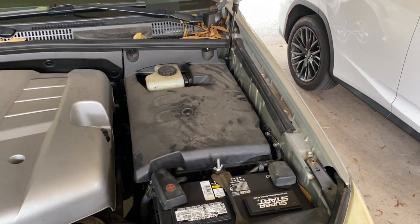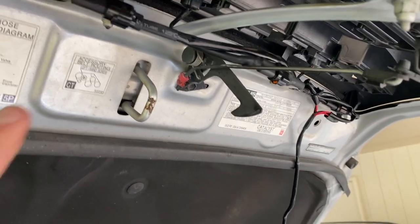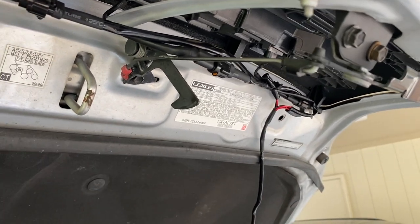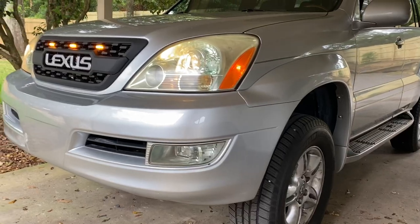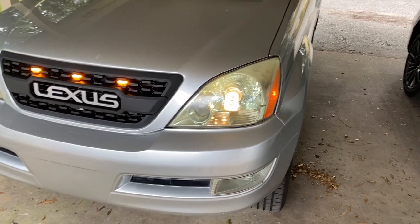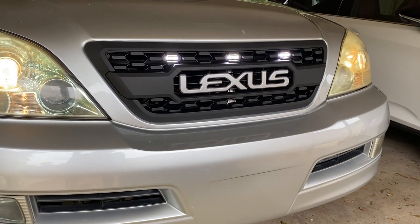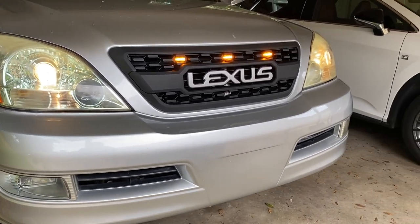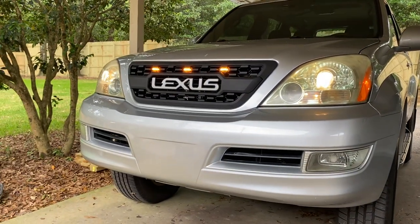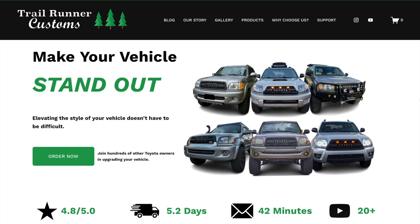I replaced the relay and fuse cover, and it does a really good job hiding the wires — it just comes right up there and onto the lights themselves. One thing to be careful of: make sure you run your wires behind this bar. I had one wire running through the mechanism and it made it so the release didn't fully open the hood, so I had to reroute them behind the bar to keep them out of the way. After that, you have officially installed the new Lexus grille and wired the lights. It really updates the look of the GX470 and brings a new, modern look to an older vehicle. We also got a couple shots of what white LEDs would look like — still fierce and updated. Overall, the grille upgrade was pretty easy and quick — it didn't take any complex tools or lots of prior knowledge. Check out the link in the description to pick up your Lexus GX grille today.